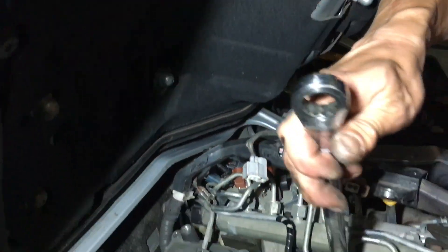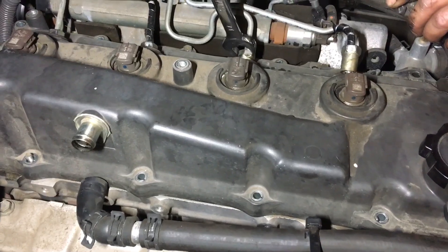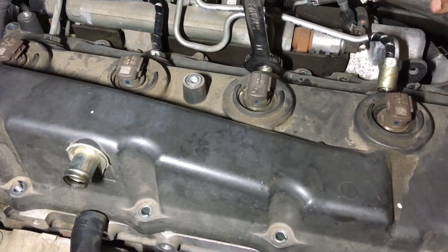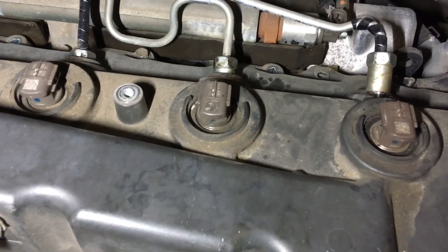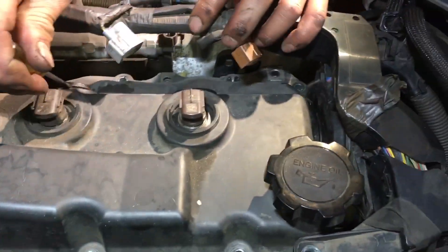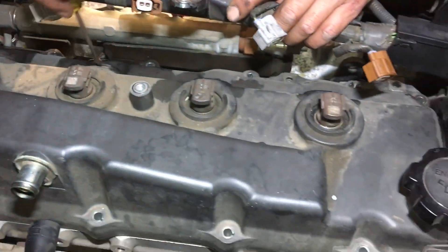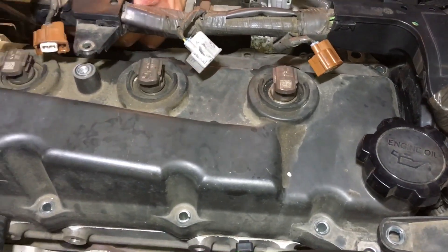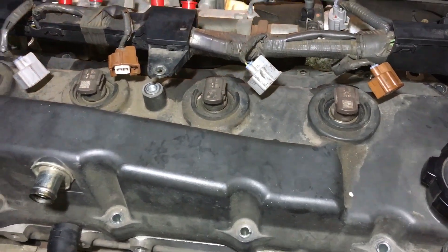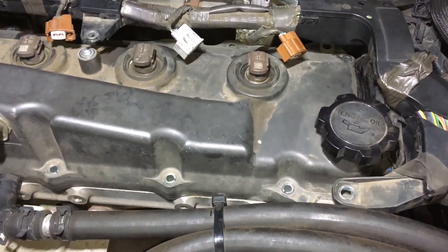It's pretty clean because you've got the seat covering. It's not a full drive so it's not going to get as dirty. We're going to clean up with compressed air because we don't want any dust or dirt falling off that wiring loom into the injector inlets. It's going to get all new nozzle seals. The pipes are a bit shorter so the jack-in-the-box effect isn't quite the same. Soon the valve cover will be coming off — much like the 1KD injector replacement videos from here on in.